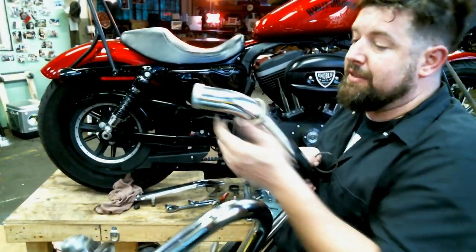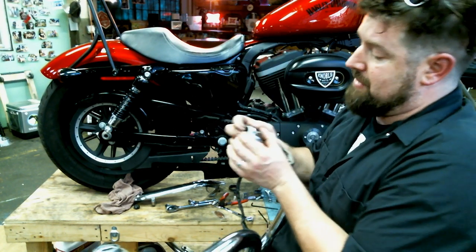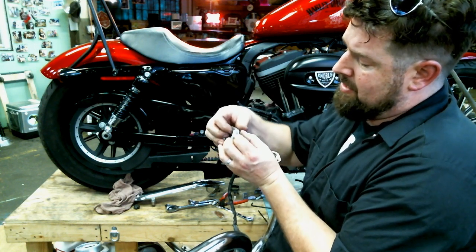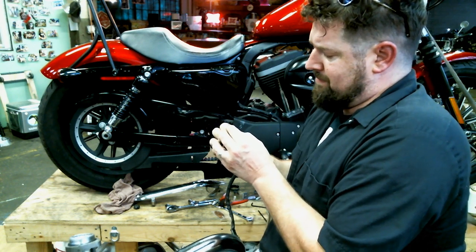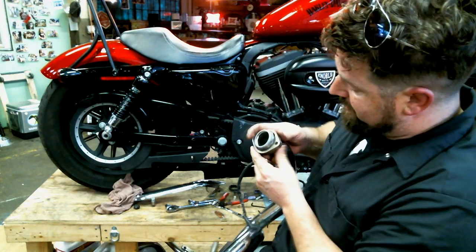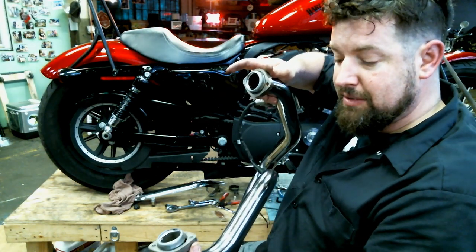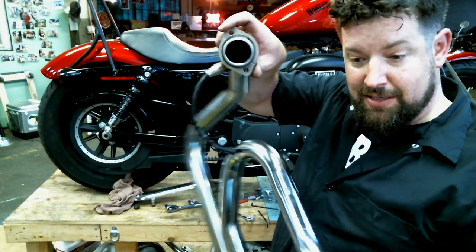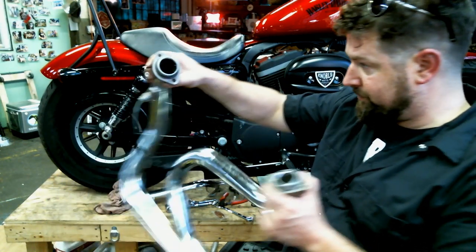All right, I already got the exhaust flanges on here. Next, we're going to pop the snap ring right over here. We use snap ring pliers to spread these over, slide them over the top. Sometimes you can just get lucky and take your fingers there. Maybe with a little luck, they'll slide on over. Ta-da! Didn't even draw blood. How about that? You want to make sure when you slide the flange up that they do sit down inside the flange there and not sticking out anywhere. That was the problem we had with the old one. They put it together, someone didn't pay attention, and the flange was sitting on there on a cocked angle like that versus sitting flat up against it like so.